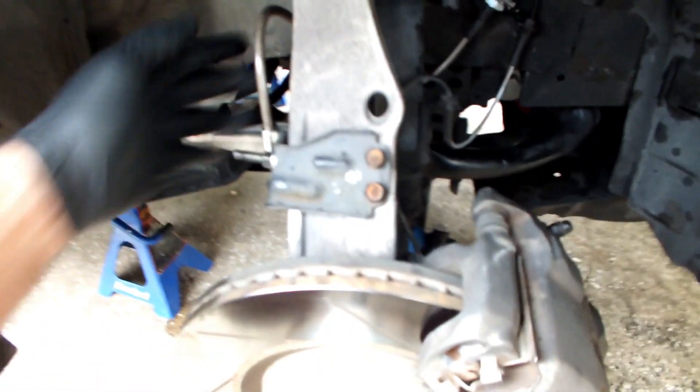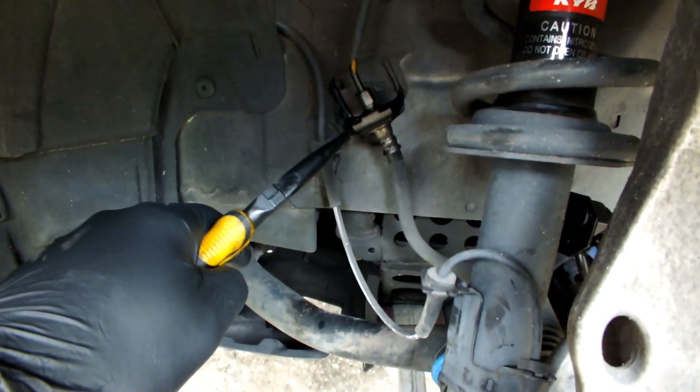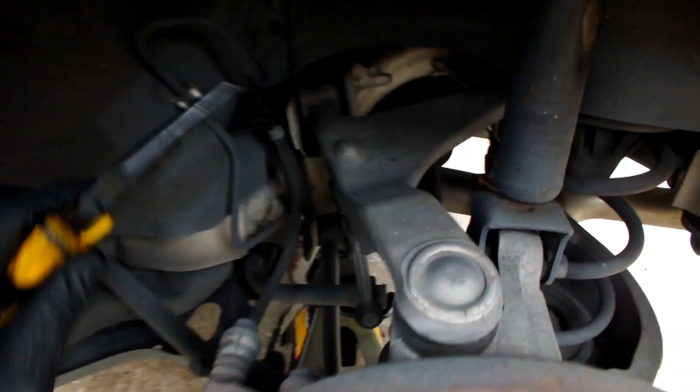It's pretty simple — you just take off three bolts. The clips can be kind of a pain, so I'll show you. What you need is a beefy needle nose plier. There are two ledges on the clip — what you want to do is pivot the needle nose plier on that edge and twist. See how it just literally popped out? Same goes for the back. You pivot and you twist — don't pull, because you won't be able to get it out.